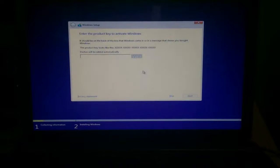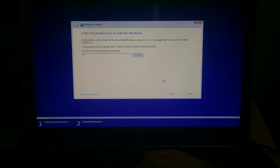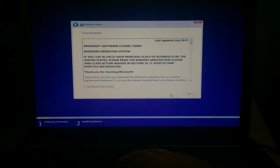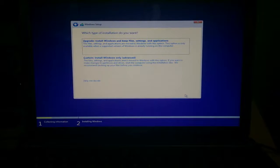Select your language — English US or whatever region you're in — and click Next, then click Install Now. At the beginning of the installation it's going to ask you to enter the product key. I don't have a product key so I'm going to skip this step — there's a Skip option right there. Next, accept the license terms and click Next. It may freeze a little bit but that doesn't matter.